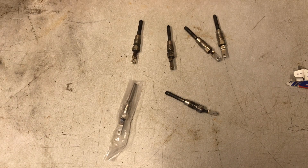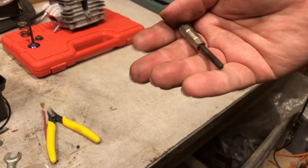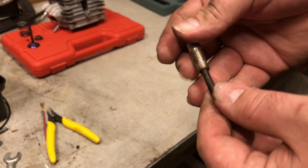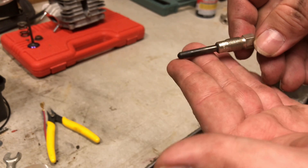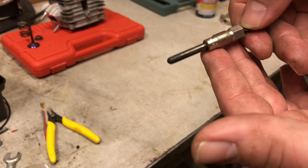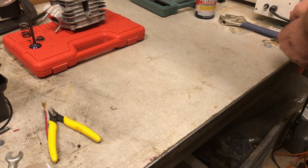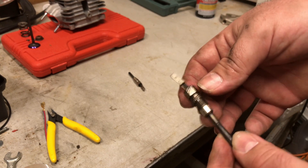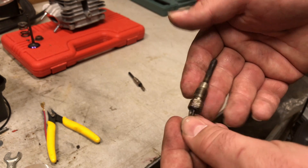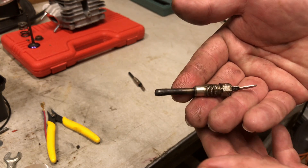Sometimes those are hard to get out of the cylinders when that end swells up like that. This is a good looking plug here — nothing wrong with that. But Jared's going to go ahead and replace them anyway, because like spark plugs, even if it looks good, you've got so many miles — maybe every 30,000 miles or so, you'll want to replace them. Or you'll end up with something like this swollen one.